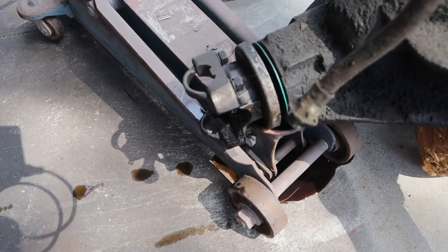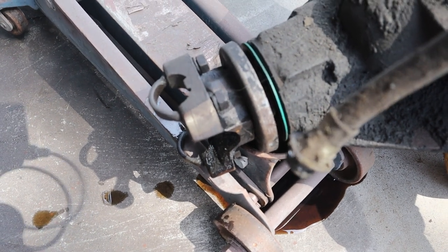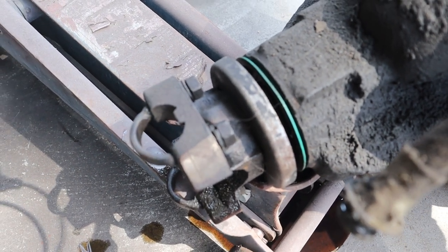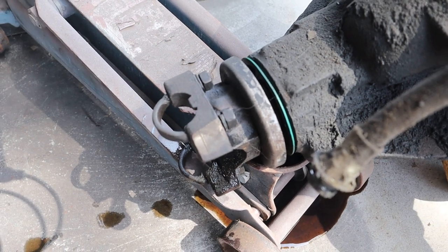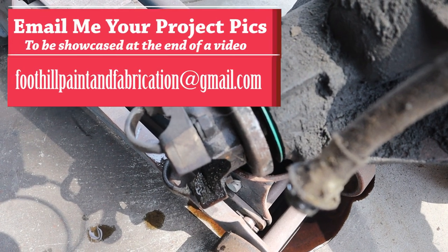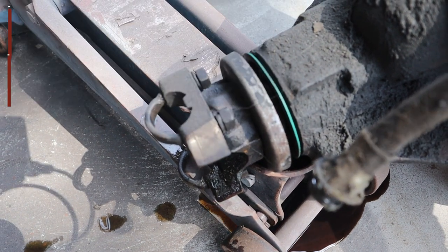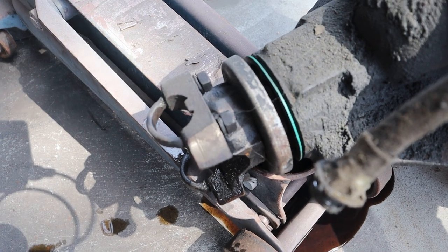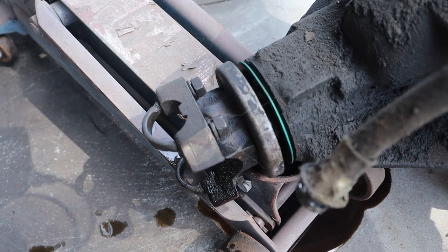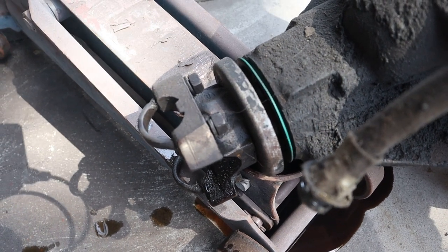You can see the yoke just kind of fell out, slid forward by itself, which is not a good sign. That seal right there looks pretty new, and obviously somebody tried to change the front seal already and it didn't stop the leak. I'm worried maybe the bearing is shot — the front pinion bearing — or maybe the yoke is scored so bad, or maybe they just didn't do it right. Crossing my fingers that since the nut was so loose, maybe it wasn't done correctly or the nut backed off and caused it to start leaking. I'm going to get this out, get it degreased and cleaned up, pressure washed off, and then dig a little deeper.